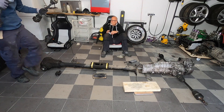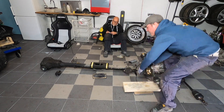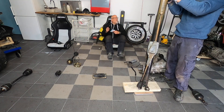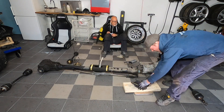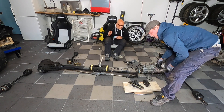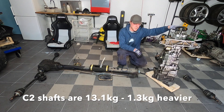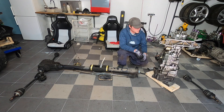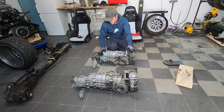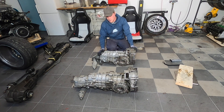Actuator unit with solenoids: 2.6 kilos. The two front drive shafts: 12.2 kilos. The big component — 46.9 kilos. The mount and the little rubber thing for the shifter: 1.1 kilos. Two pieces of rear shafts: 11.8 kilos. We were a little bit unsure about the actual weight of the gearbox because it sounded like too much, but it's really 81.5 kilos. As you can see, the G50 — which is the one you have on the C2 — is shorter and doesn't have this differential piece here, which the G64 has.